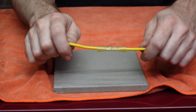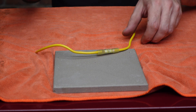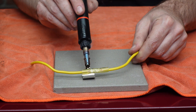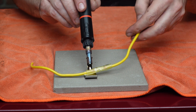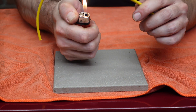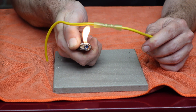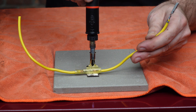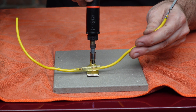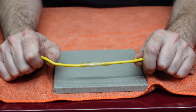With the wire prepped, we will insert it into the crimp connector and squeeze down on both sides. And there we have it — we've made a proper crimp with the proper tool. Now what about corrosion and connector tension? When you introduce some heat into these wings on the connector, not only do they shrink down, but they release a hot melt adhesive that seals the connection and transfers the tension onto the wire and away from the connection. What you should not do is use a lighter to shrink down these connectors because an open flame could melt or ignite something unintended. What I use is my butane powered soldering iron with the hot air attachment, which is much more controlled and safe. And the result is the strongest, safest, most robust crimp connection with enough longevity to outlast the vehicle itself.